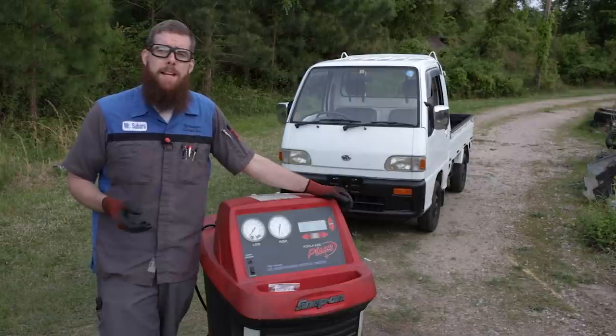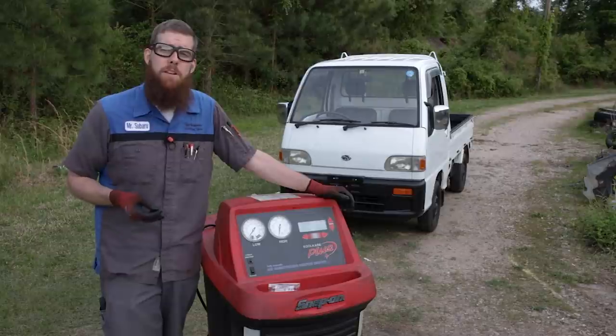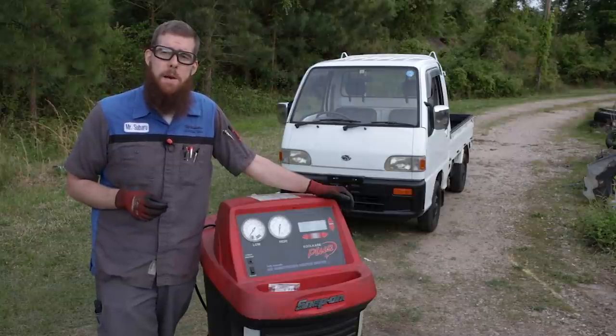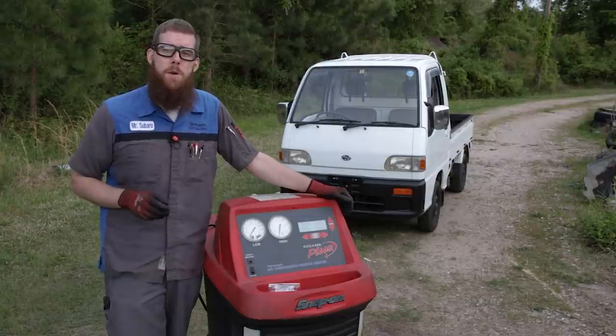I've gone all around the truck with the UV light looking for any bright yellow fluorescent dye leaking out. I'm not seeing any visible dye around the compressor, the lines to the condenser, or up to the evaporator in the dash — though I didn't go that far. We're probably going to have to drive the truck or wait a week or two and come back and check it again. Temperatures ended up pulling down below 40 degrees into the high 30s — I'd still like to see it a little colder, but driving at higher RPM would likely drop it further. So we'll put the truck back together, drive it a week or so, and come back in a part two video to find where this leak is coming from. Thanks so much for watching — hope you enjoyed the video and I'll see you in the next one.